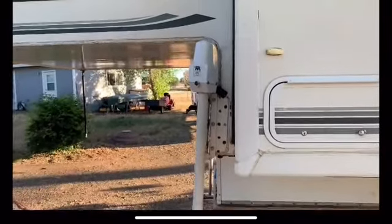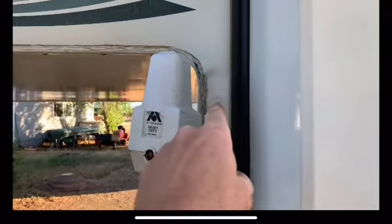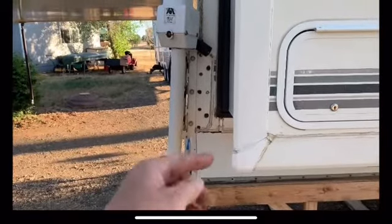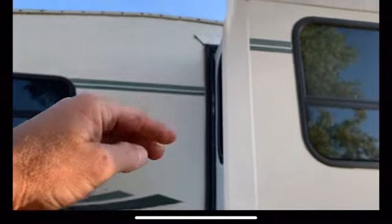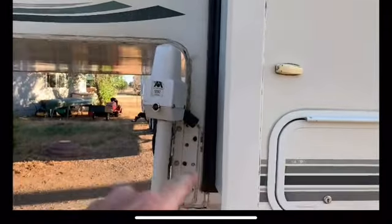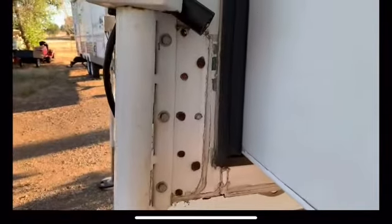You can see that this corner is rotted and it's at an angle, and it's already starting to crease there on the Filon. So again, piece of aluminum, 90 degree angle all the way up, wrapped around the top of the roof, bolted down, construction adhesive all the way behind the aluminum, all the way down. It'll have to go behind this jack, so I'll just drill holes through it. That way the mounts can still be bolted through to the backing plate.